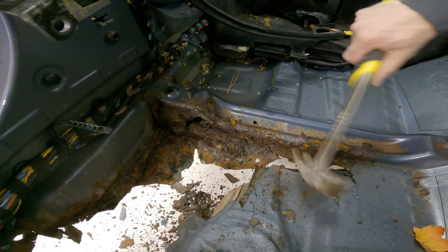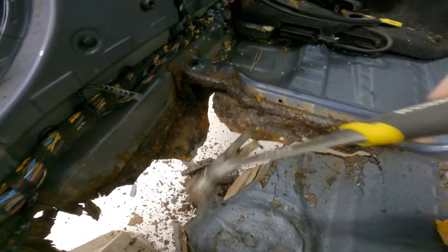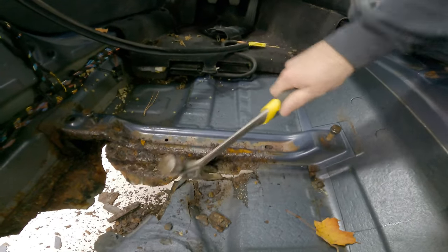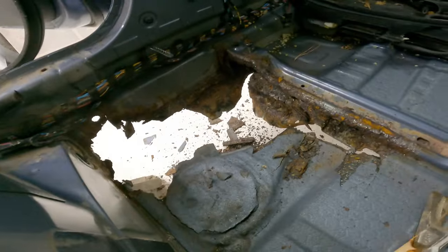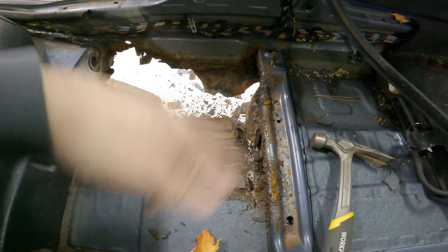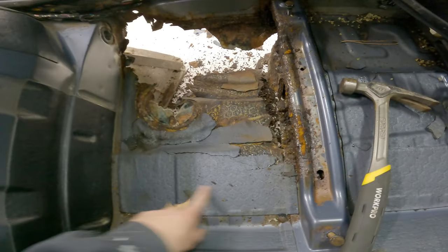Look at this — oh my god. When I bought the car I didn't expect this, but when I saw underneath and the rocker I expected something like this. But this is like totally gone. I did not expect the seat rail to be rotted at all. I thought I could weld a piece in here, but realistically I don't care about this car, so I think what I'm going to do — since this is all solid and just starting to pull away from the body — I'll cut this off here and just make up a rectangle piece, flat, maybe run some beads in it for a little bit of strength.